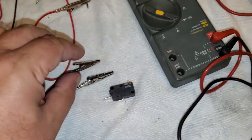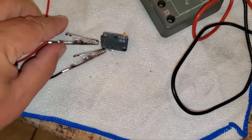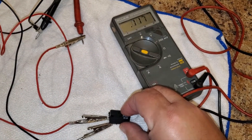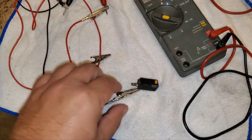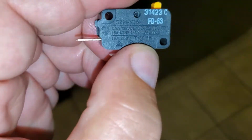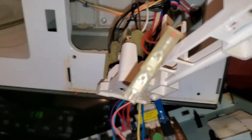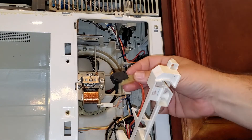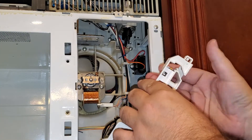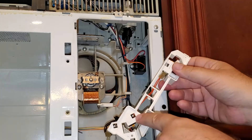Here are our new parts from Amazon. We got a package with a 63 and a 62, and I went ahead and bought an extra 63 because there are two in the microwave. I'm going to test the new switch first — just the meter in continuity mode, hook it up, push the button. Works perfectly. So we're just going to take this new switch, go back to the microwave, and install it. We've got the new switch plugged in and going right back in the hole where it came from, into the connector until it clips in. That one's good to go.